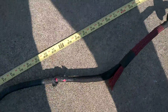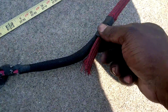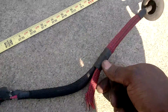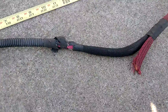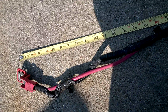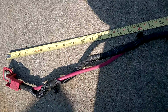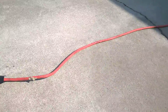You usually have two wires that come off of here through this grommet. This one is cut, which I'm not worried about — I'll get a replacement. But here's where it's a splice: this one goes down to the starter, and then this one goes to an under-hood fuse block. I could just make this one run down to the starter and then come off the starter up to the junction for the fuse box under the hood.